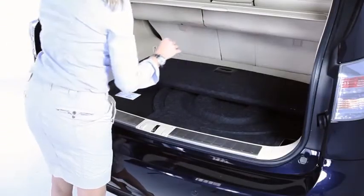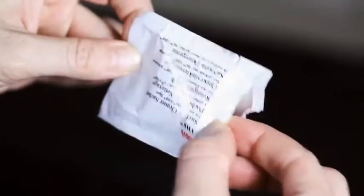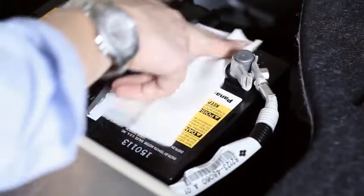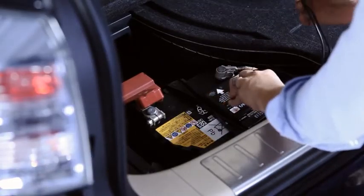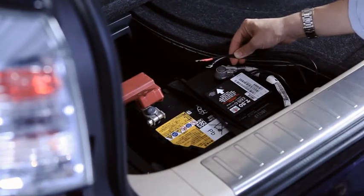Follow the vehicle's installation instructions to find the installation area. Clean the area with the degreaser wipe where you will position the T30 box. Fix the box with the double-sided tape, being careful to place it with the arrow displayed on the box label oriented to the vehicle front.